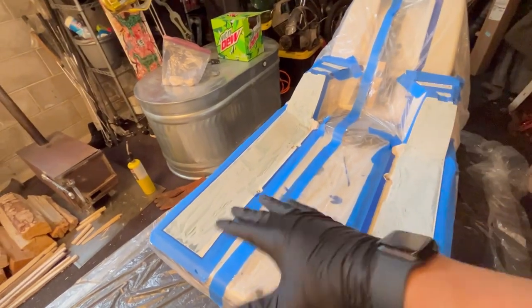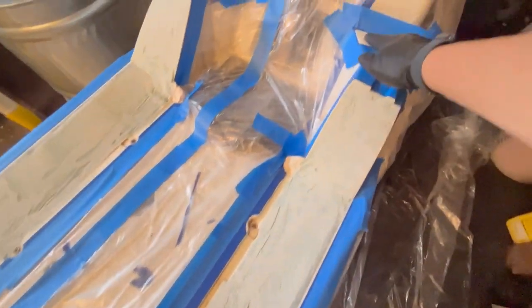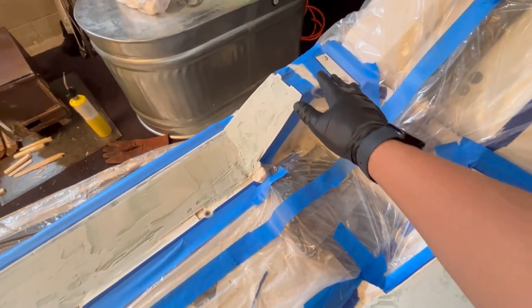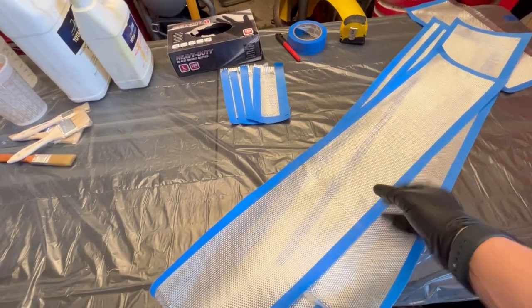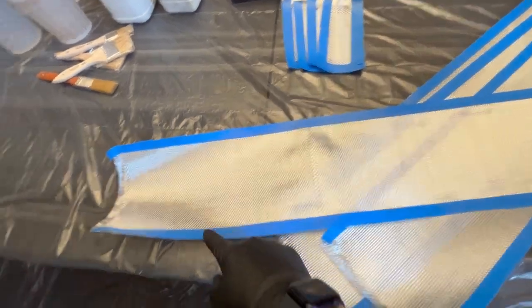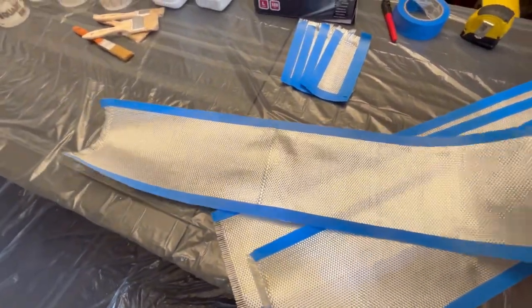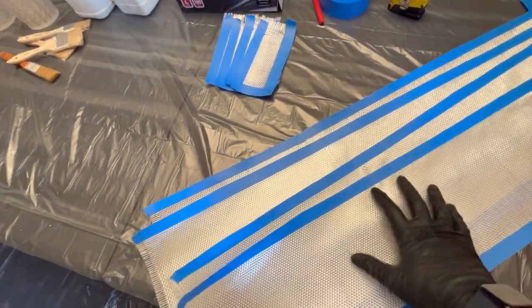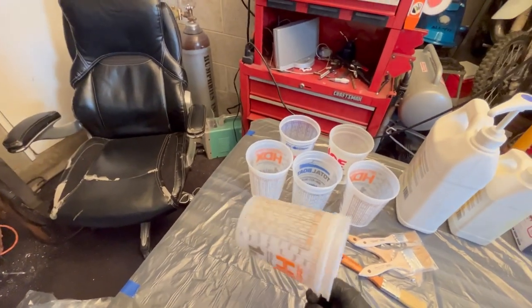All right, what up guys — been a lot of time lapses so I'll catch you up. We are sanded, bondoed, and now all masked up ready to lay some glass. We're going to glass in the side rails and the slope, and also glass up two little holes on each side where the previous pads filled in. A little trick with fiberglass: if you tape the sides — if you don't have just random twill but you have a 90-degree mesh — laying down some masking tape keeps it from splitting and twisting on you as you set it up, keeping all your pieces uniform.